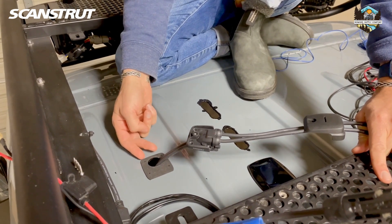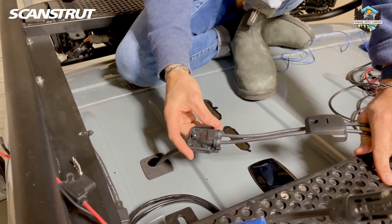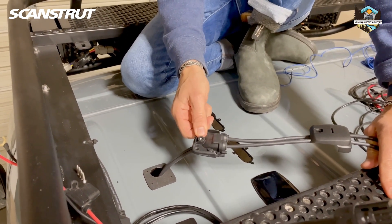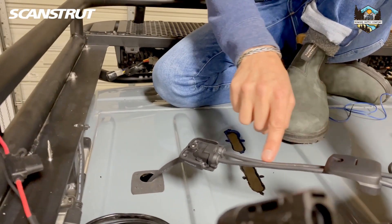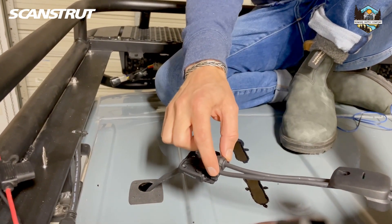Then you're going to run your solar wires up through and put this foam pad down for your DSHD6. The solar wires go up through the van and through the base of the pass-through, and then the next step is to install the rubber washers that go along the solar wire into the base — that forms the water tight seal.